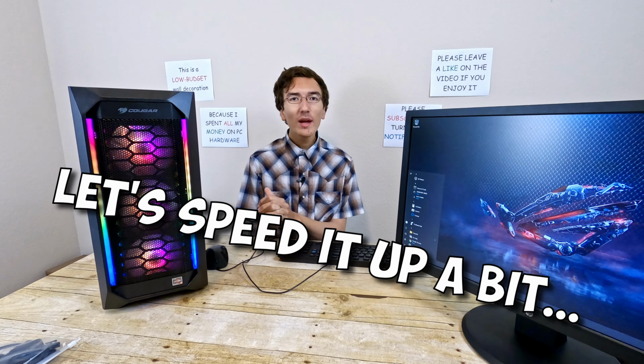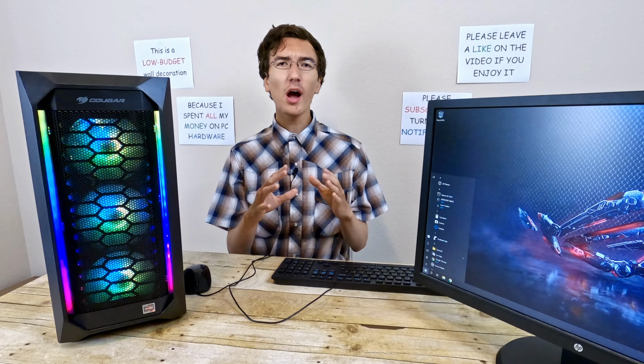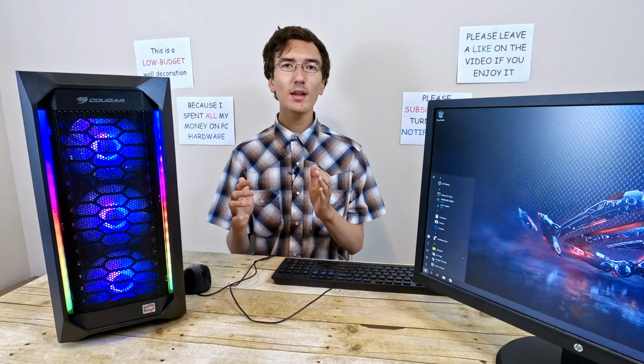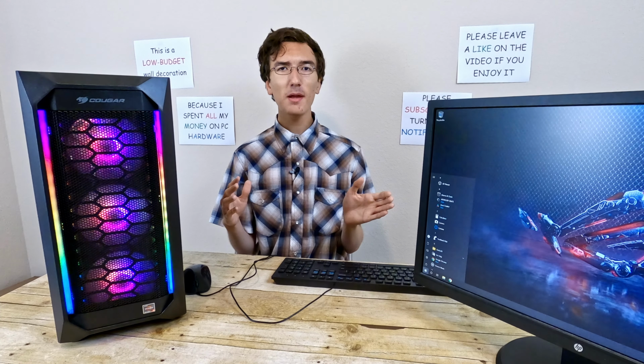This PC is fine, but Windows is just so messed up. Okay, I don't want to get into too much detail here, but let me explain a little bit. So basically I installed Windows once, and then it started to auto-install conflicting drivers at the same time, and so I was blue screening every 5 seconds, and then eventually couldn't boot. I reinstalled Windows, and then I realized that it had been partitioned as MBR instead of GPT, and if it's MBR, it won't support Windows 11.